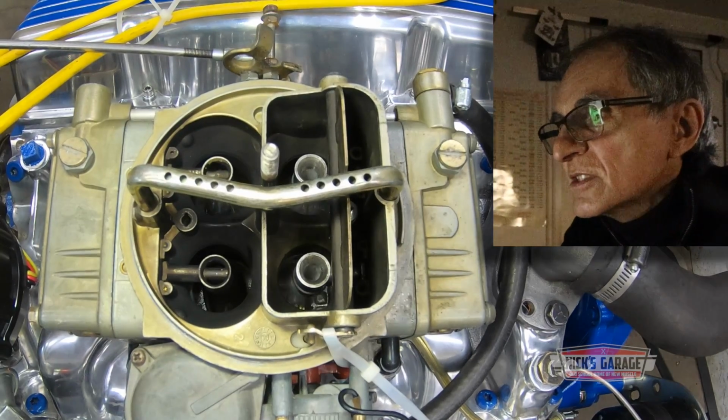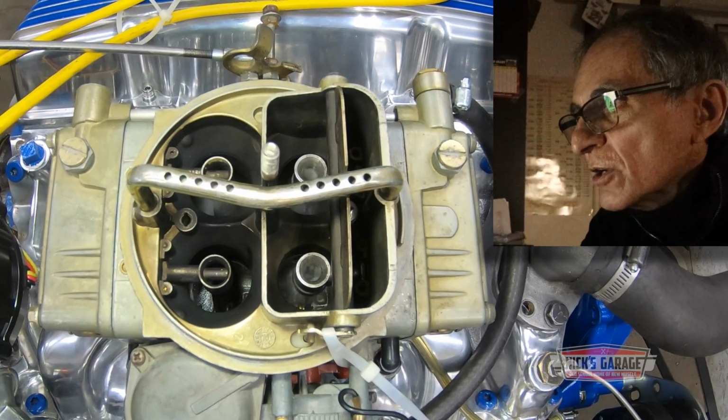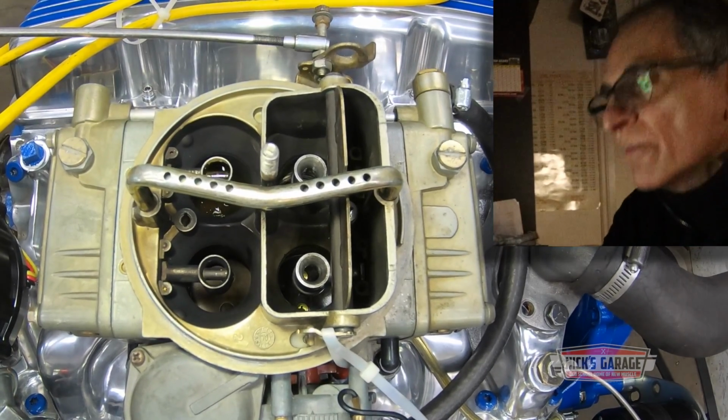Slowly going up. We've got fuel in the front venturis. Secondary is opened up. There we go. Oh my God, here we go. We got a problem here. We got 3 boosters feeding fuel and one of them doesn't shoot fuel at all. There's this problem right here. So it's a carburetor problem. It's nothing to do with the dyno feeding fuel.